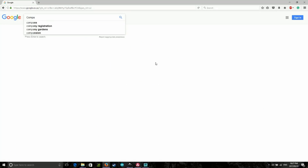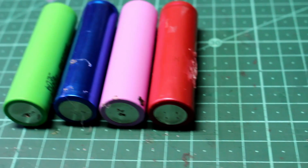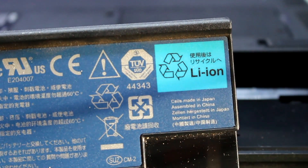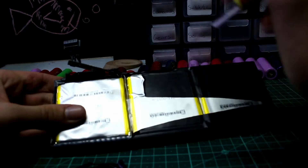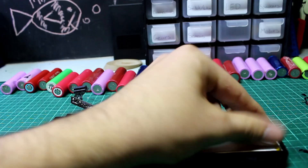The laptop batteries I've been taking apart so far are pretty old. You'll find that most older laptops use 18650 cells — the cylindrical ones. These 18650 cells are lithium ion and they're pretty great. But with most newer, thinner laptops, they use lithium polymer. The lithium polymer cells work exactly the same way but don't have a metal protective casing like the 18650 cells, so when handling them just be a bit more careful.